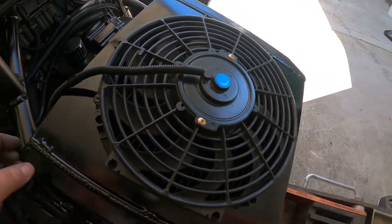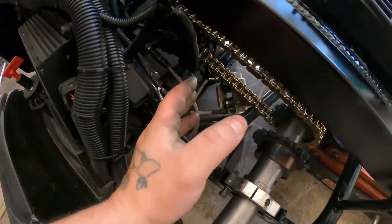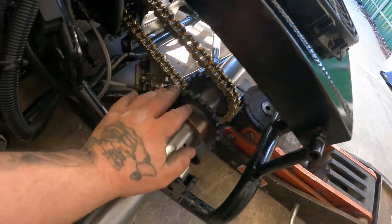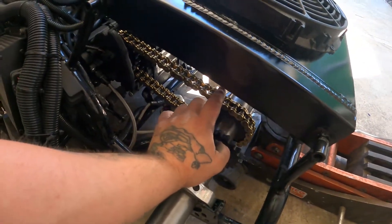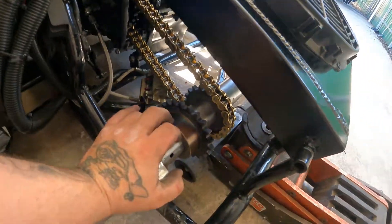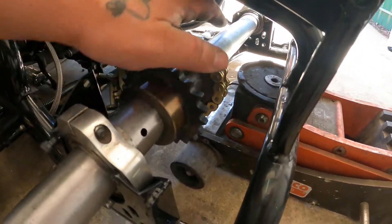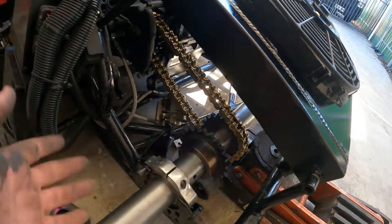We'll wait till it's dry and put some water on it. All in all it's all good — the cart's all ready. Now just to get the chain all ready to go. The smaller gear is the one I'm using; that bigger one's not needed. The small one is actually the same ratio as the booster. I've just got to get a keyway done on it now. The hubs have all been made up — thanks very much to a good mate. So I've got to take all this back off, get the keyway made up, get it all back in, and ready to go.